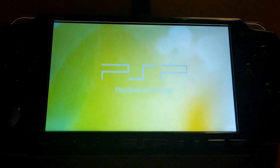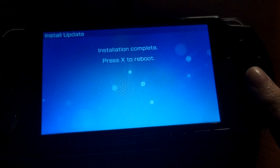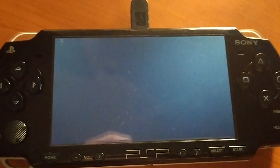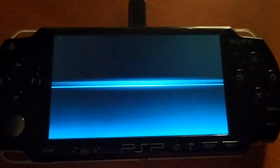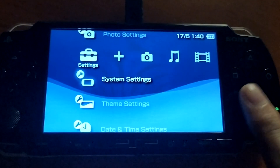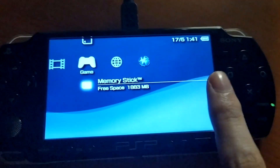Boot Infinity 2 and it will show you a screen where you have to press X. It will say 'installation complete' once done. Press X again to reboot. When it reboots, the PSP will start apparently normally — it will take a little bit longer than a normal reboot. Go to System Settings, check your system version, and you should see the Infinity symbol near the firmware version.